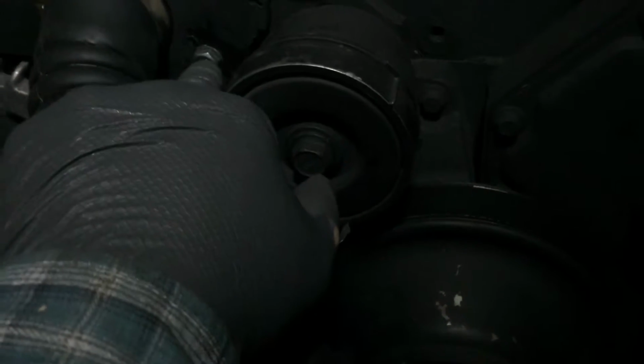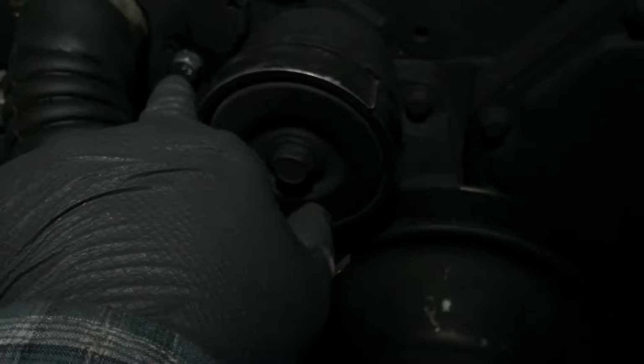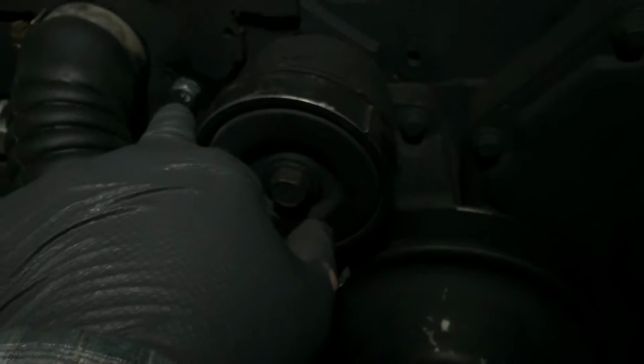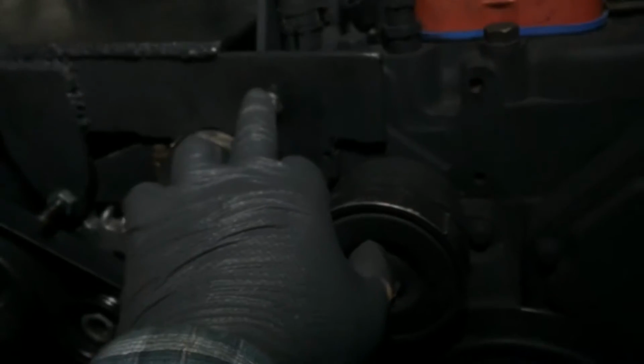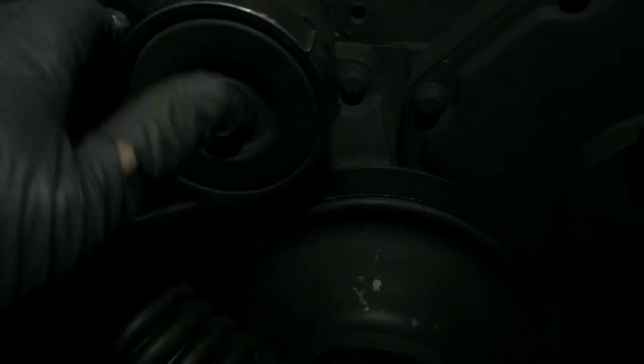This little bolt right here had backed all the way out. You know, they always talk about the 4BTs that shake the bolts out. I hadn't had one actually come out yet. This one bolt was all the way out. But the good thing is my AC bracket is connected here, here, here, and here, so it's not like the AC bracket was going to fail, but the idler had gotten, I guess, loose. The idler had started pushing up with less idle on it, or the tensioner arm. So that was interesting. I Loctited this, Loctited that, and though that didn't come loose, I went ahead and Loctited that.